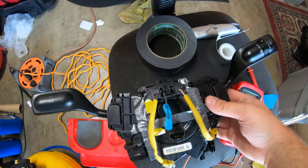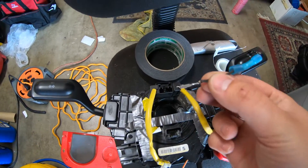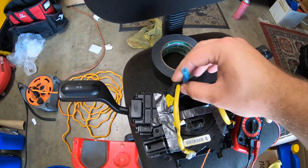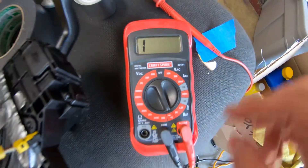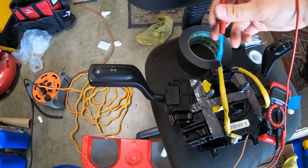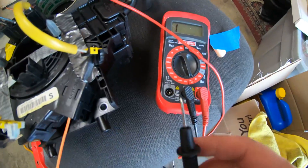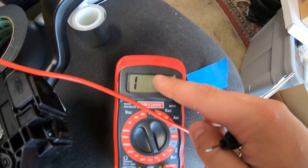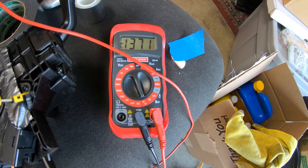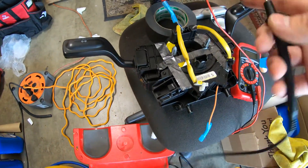Here's the clock spring out right now. I got it all taped up so it doesn't spin. I've set up these tiny pins that I have spare — I'm plugging them in just to make it easier to figure out which one is which. Then I have my multimeter set to the continuity level and I can just plug them in here. You'll actually hear it making noise for continuity — one means it's open, no continuity, and anything other than one is continuity. So you can actually hear it. I know which wire goes to which pin.